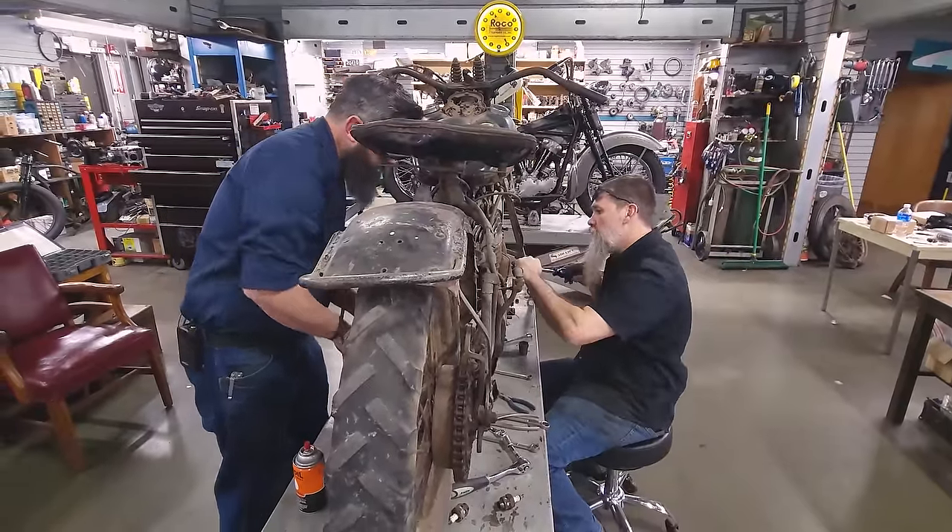What's that primary look like? That's not bad — chain's loose, chain's oily, that's good. A little bit of up and down. Big sprocket on there, 27-28 teeth. First glance, I don't think we've got to disturb that. It would sure be nice to know if that clutch separates. They've actually cut a drain out, and this primary cover has been beat up and abused so many times they welded a plate on it down low. That's so cool.